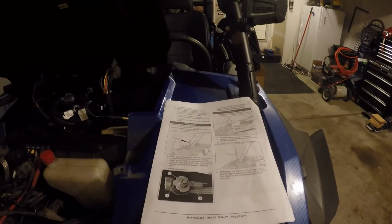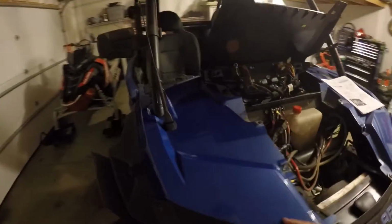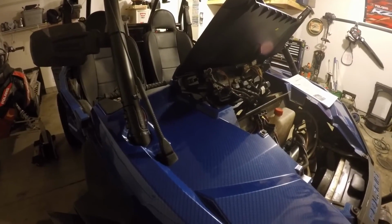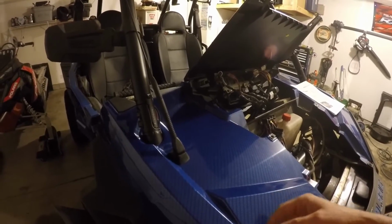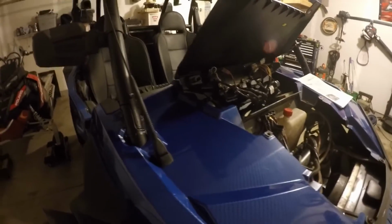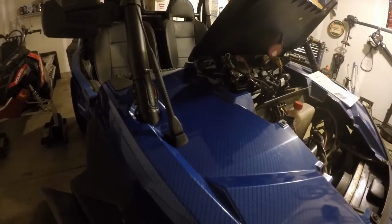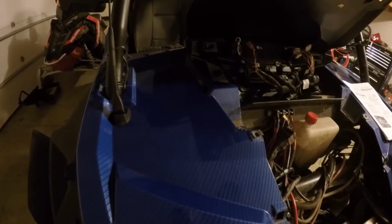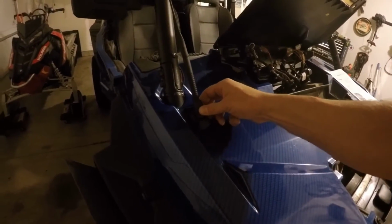And okay, page 6 of the instructions is the installation of the AM/FM antenna. And as you can see, it basically gets installed right here. I mean, you technically could probably put it anywhere you want on your machine. The cables probably are most effective used somewhere here on the front dash. You have to drill 2 holes at this time. It was a 1/2-inch drill bit and a 3/16-inch drill bit, and that's for the actual antenna mount here.